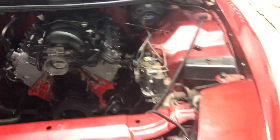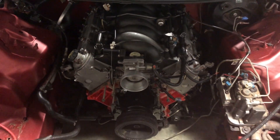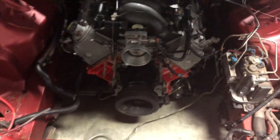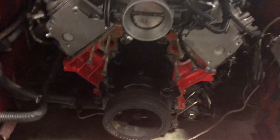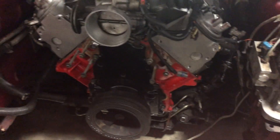Starter is on halfway, which reminds me I need to go get a nut for that. I don't have a lot left before we crank it - I gotta get some Trunnion upgraded rockers, which are on the way. I also gotta drill and tap the hole for the block since this is a truck motor, not an LS F-body motor, so the accessories don't really work as well.